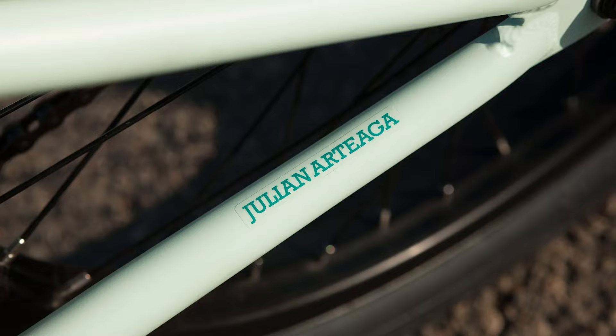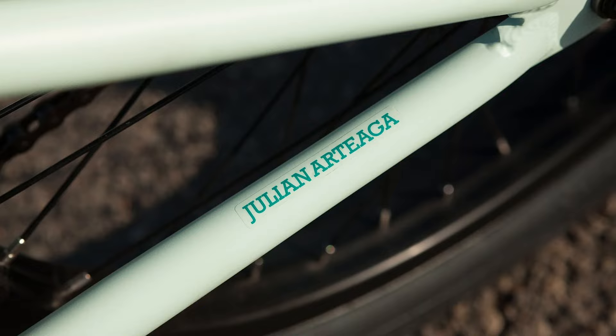Because of this quality, I'm not really going to give the bike a weight limit, but if I had to assign a number, I'd say around 200 pounds — maybe 210 or 220, you'd be fine. But if you're significantly heavier, like 250 plus, even though this is full chromoly and good quality stuff, you're going to have issues: chain breaking, the Sunday Sabre 2 sprocket bending — it's just a steel sprocket, not an alloy sprocket. Things are going to happen if you're over 250 pounds. If you're right around 200 or less, this quality is going to be good and it's going to last you quite a long time.